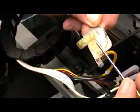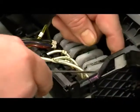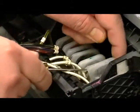When lifting off the dampers, be careful that the screwdriver only contacts the hard white plastic as shown. Using a flat-bladed screwdriver, lift off all of the dampers.